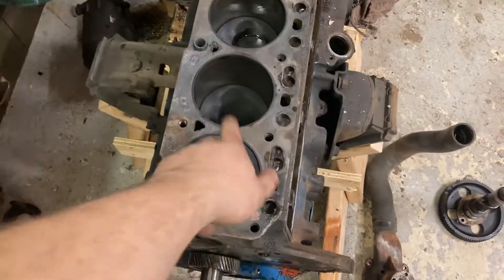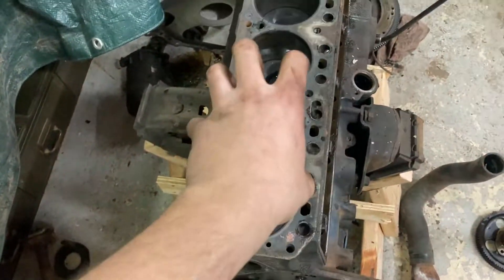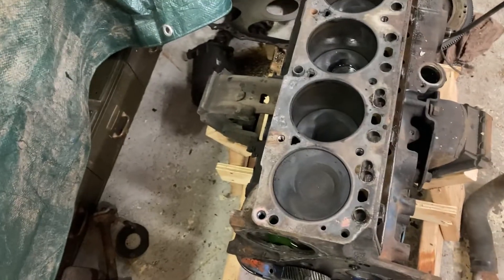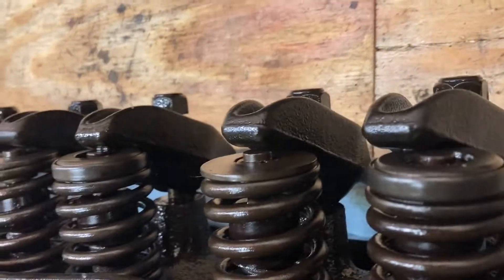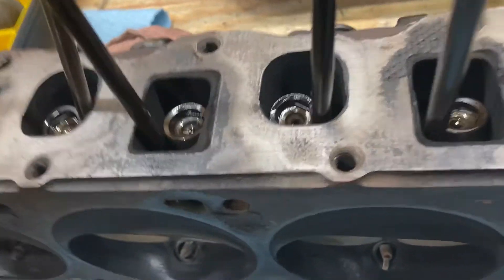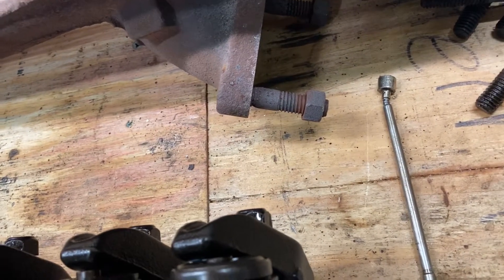Number one was a dead cylinder. You could hear it in the oil cap. So it could have been valve stem seals, maybe? Those don't look all that bad from what I saw, but we'll see. Could have been a bad intake valve blowing past the valve stem seal and making it sound like it was coming out of the oil filler cap. Who knows? Doesn't matter anymore — it's getting pulled apart.